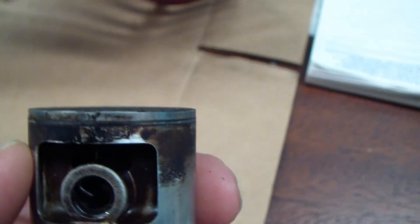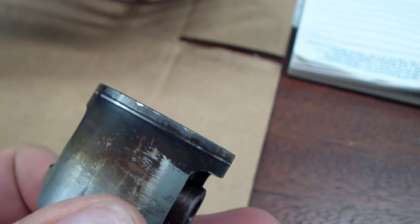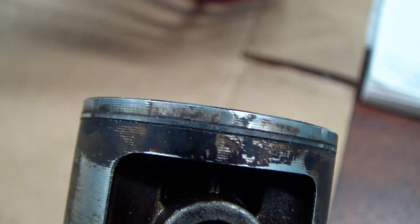I'm thinking about this piston here. It's got a stuck piston ring — you can kind of see all the blow-by, all the varnish, everything stuck in there. If you take a magnifying glass and look near the top, you can see the whole upper gap is completely filled in and this ring is kind of glued into place. It's pretty badly stuck. Here's kind of the worst area of it.